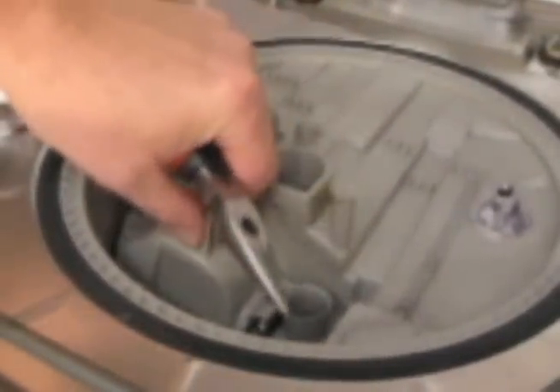Once you have loosened the screw to the inlet protector and taken that out, you can remove it. Sometimes it is a little bit harder to remove — take a pair of needle nose pliers, give it a firm yank, and that will let it come out. And there we have our problem: paper and other crud blocking the screen.